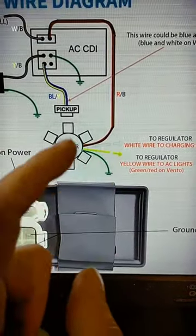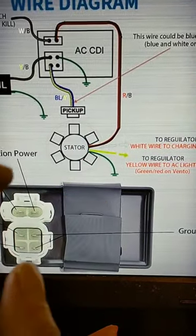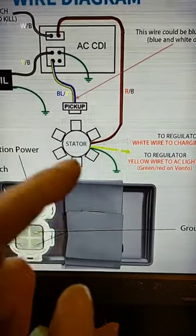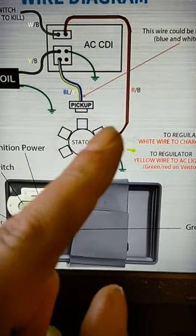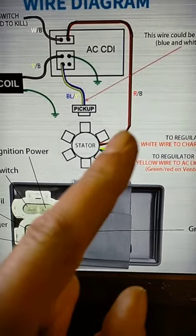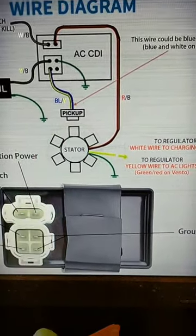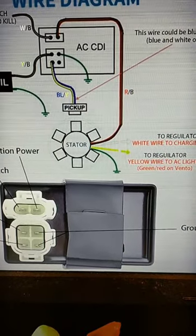You have two hot wires. One goes to three of the coils, and then the other one goes to the other three. This is a similar picture — the diagram is kind of wrong, really. And then you have the hot wire that goes to the CDI as the seventh coil. If you count the coils in there, there are seven of them.